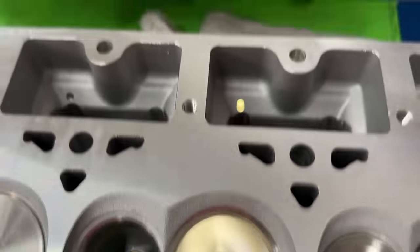As for the rockers — you might wonder how they'll line up if the valve got moved over. AFR includes their own stand when you order the heads. It simply bolts on and allows you to use your rockers — they've adjusted the position so it lines up correctly. It comes with it, so no extra cost. For piston pockets: most LS3 engines have flat pistons with no valve pockets, so not a big deal. And even on aftermarket pistons, because of the smaller valve, the center is shifted over but most manufacturers make the valve pocket wide enough to account for spacing differences. I'd check with your piston manufacturer, but in general it's rarely an issue.